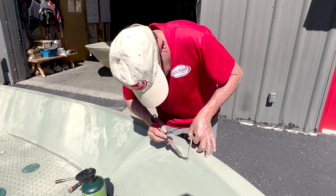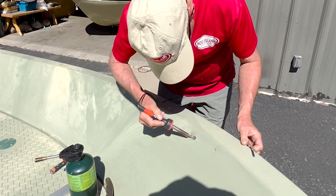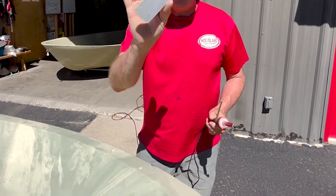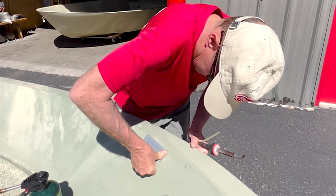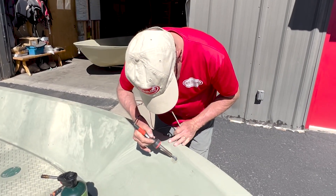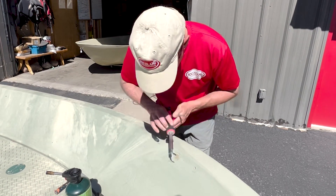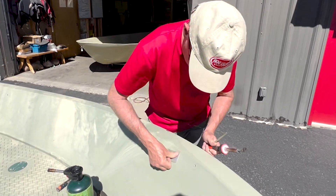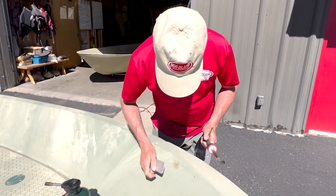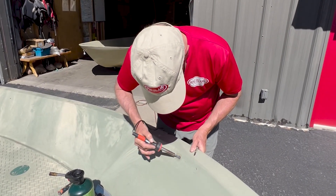Backfill with it. I'm going to pull off that little hot end right into my little hole and smear it in. Once I get it to that point, I'll use something flat — this could be a paint scraper — to hold it and really get it to bond. I'll clean my tip, come back on it, and press her one more time. Now we'll let her cool just a little bit. I can sand that little edge out right there that's a bit discolored — that's where the marshmallow cooked just a little too much.